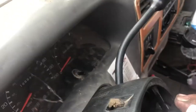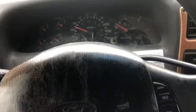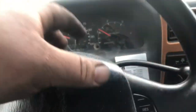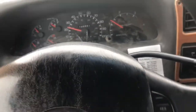Apparently my wheel wasn't completely straight because it wants to be over a little more, so I'll fire the truck up and move the wheels to straighten it out. We got the old steering wheel back on now and we have a horn — so the clock spring is all working. The only thing I had to do was rewire the plug-in since it was different on the new one. Looks like I'm going to go out and test cruise control.